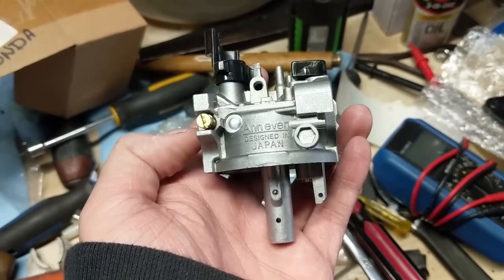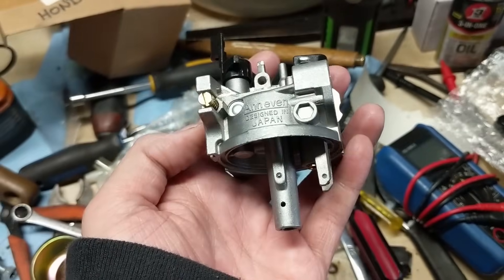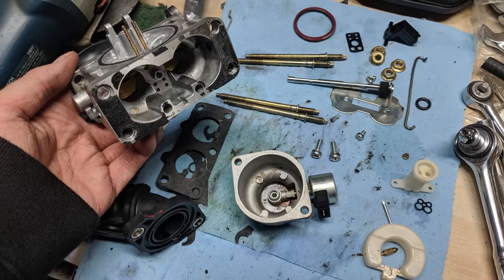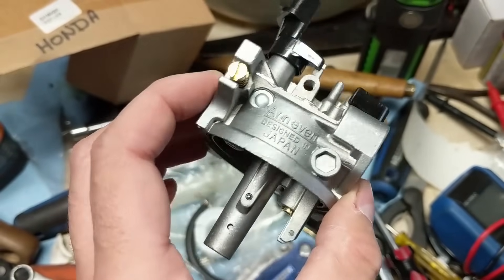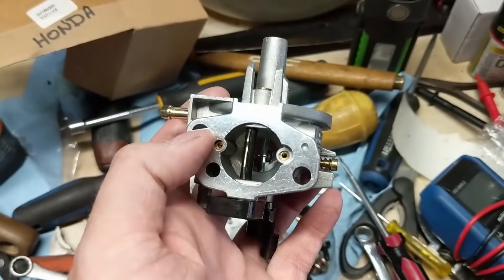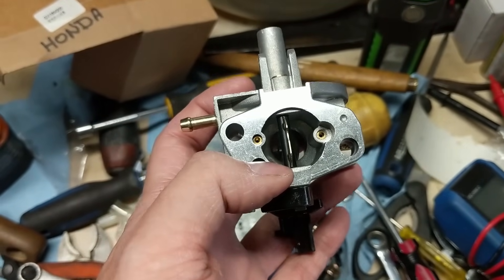That's pretty much it for explaining how a carburetor works. It can seem a little complex, especially on V-twin engines with what's known as a dual barrel carburetor — taking one of those apart is pretty complex with many parts. These single-barrel carburetors are a little simpler with fewer parts, but essentially every carburetor works the same. The job of a carburetor is to simply mix a metered amount of fuel with air and then supply that to your engine. That's it for today's video. I hope you enjoyed learning about how a carburetor works. If you did, think about leaving me a thumbs up — it really helps me out. You can click here to subscribe and click over here to watch one of my previous videos. I upload every single week, so be sure to stop by next week. Thanks for watching.